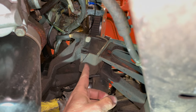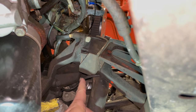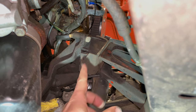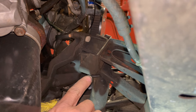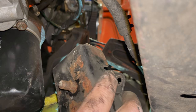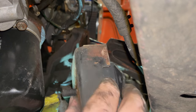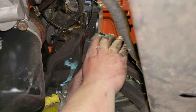This last motor mount looks pretty easy — it's the same style as the one I just replaced. You have a nut over here and two bolts over here. Again, this one will probably have to be done from below the car because you cannot access this nut from up above, at least not easily, although the two bolts you could easily get to from above. I do have a jack underneath the engine supporting the weight so this motor mount can come out. This one was sitting in a little metal container, so just pull that out, put the new one in, and it's ready to go back in. Now I'll lower the engine down and tighten up this nut.